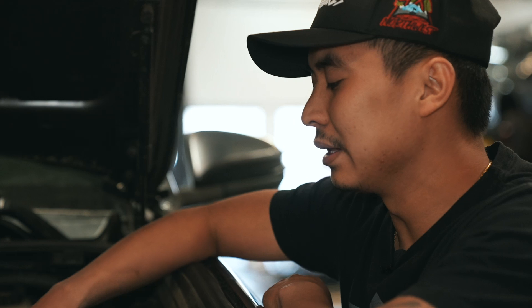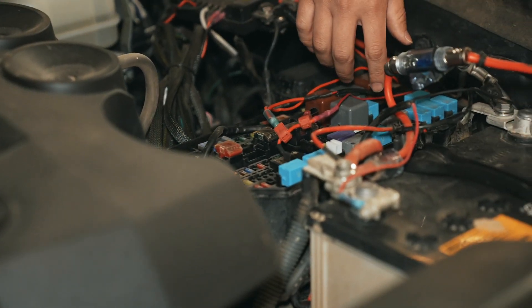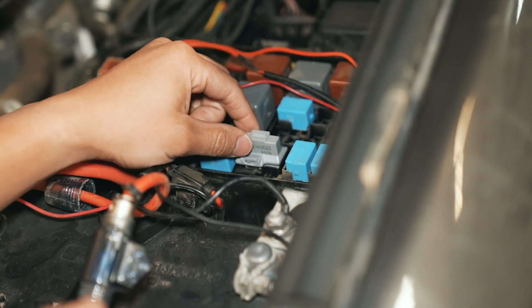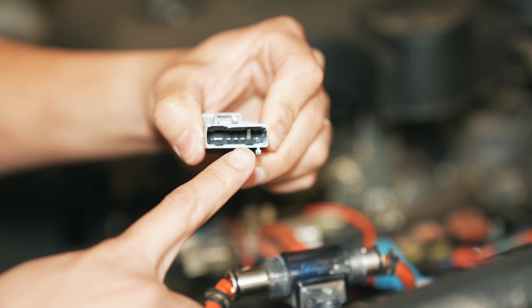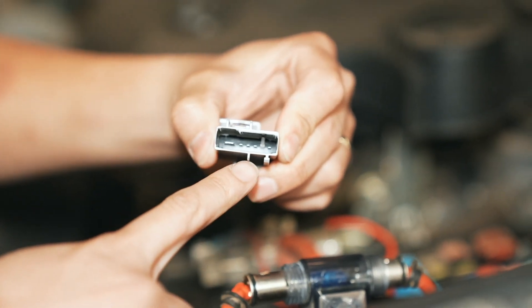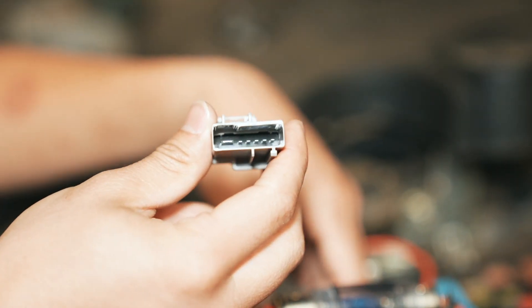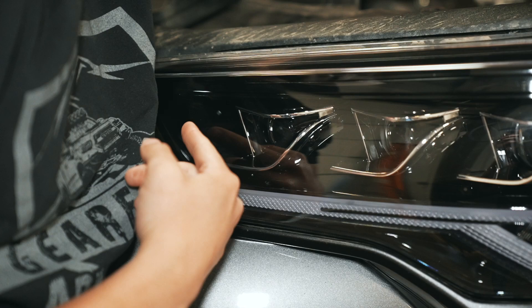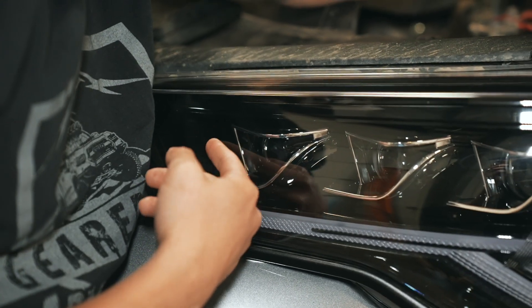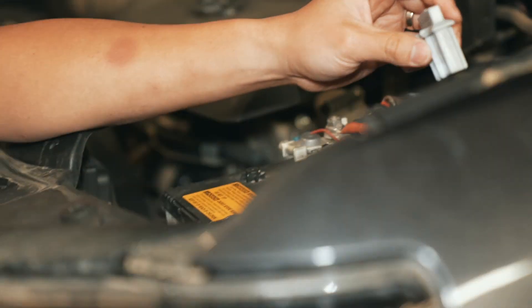The installation for these headlights is pretty similar all around for all headlights, but there is one thing you have to do that's a little different for these GTR headlights. There's a gray relay in between all the blue ones — pull that out. From right to left, the second pin in there — you can see we flattened that and pushed it out of the way, so when you plug it in it doesn't make contact. If you have a regular one, all the pins are straightened. If you have that pin in contact, when you turn on the lights the inner bulb — your high beam slash DRL bulb — will flicker. That's why you flatten that pin, plug it back in, and now you won't have any flickering issues.